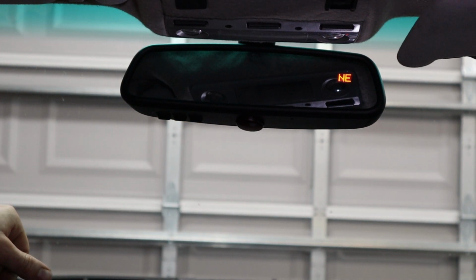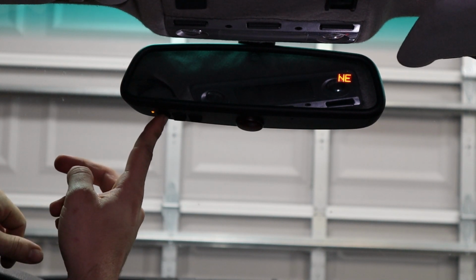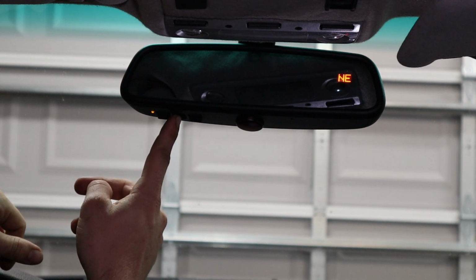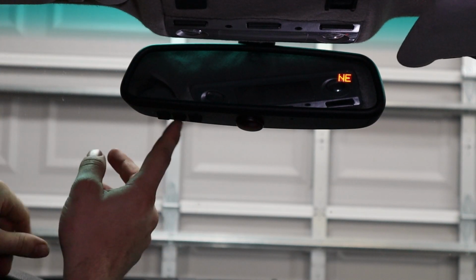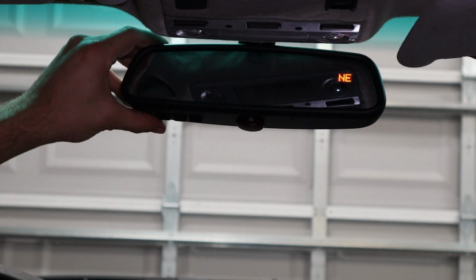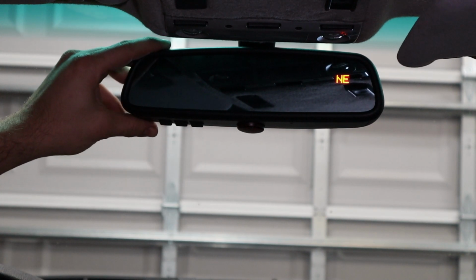And to test and see if a button is programmed or not, you go ahead and press on the button, and then it will start blinking because it's blank. If you press on the button and it blinks really fast, that means that it's trying to actuate the garage door that it's programmed to, and it's trying to carry out that function. So it cannot be programmed until the programming has been erased on it. So to remove all that programming, that's what we just did.